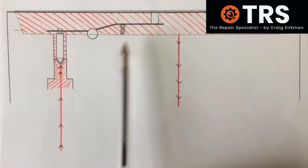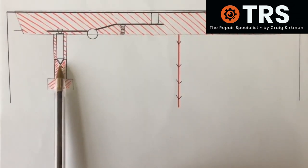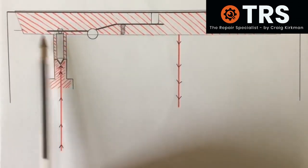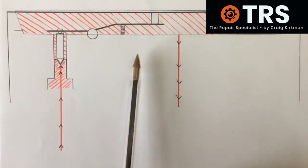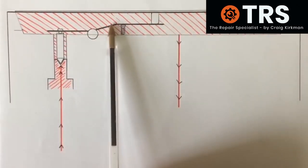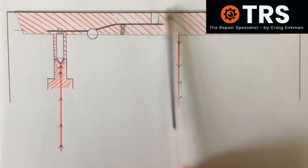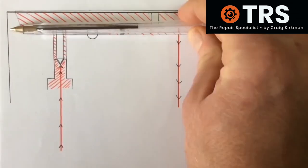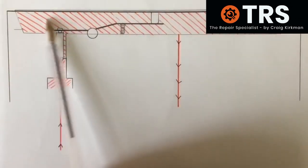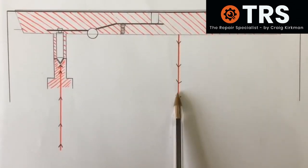This sketch here is a side view of that. Fuel comes up to the bottom of the needle valve, and when it gets there it can't go any further because the needle valve is fast on its seat creating a seal. The reason for that is because there's fuel already up here, in between the carburettor body and the diaphragm. This is the diaphragm here. This being the metering lever — it pivots like this. But because there's fuel here it keeps the diaphragm up, so that little spring there allows the back to stay up and allows the front to stay down, pushing the needle valve onto its seat. The reason there's lots of fuel up here is because the engine is either using very little or none at all.